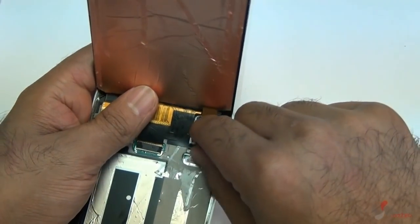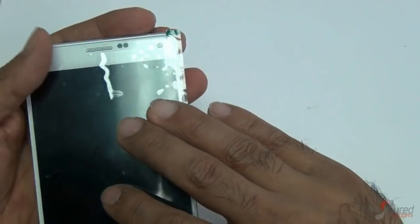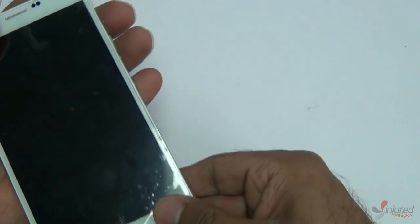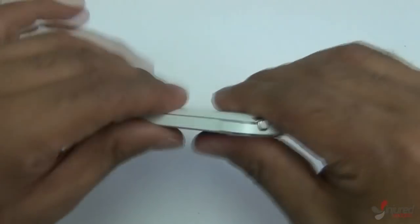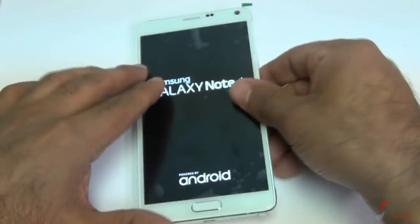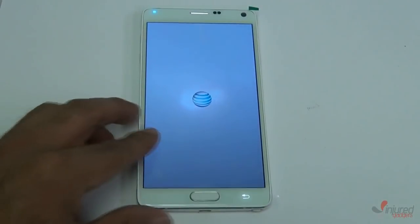Plug in the left flex cable first, then plug in the one on the right since it's a little longer — plugging in the right one first makes it more difficult. Once both are snapped in, make sure your screen is down and the home button is positioned properly, because misaligning it could crack your brand new screen. Turn it on, and sometimes I'll place a notebook or stack of books on top so the screen has time to set with the adhesive. And there you go — your Galaxy Note 4 is fixed! Make sure to like us on Facebook, comment below, and follow us on YouTube.